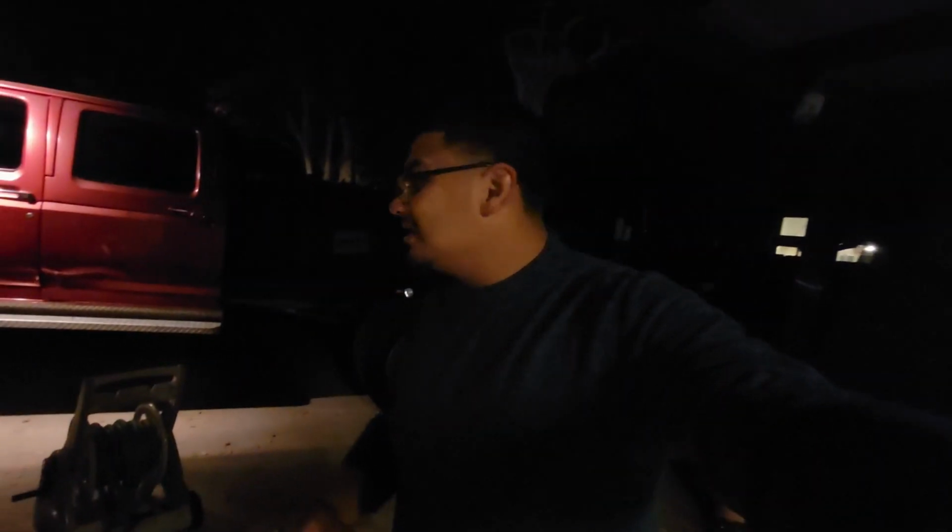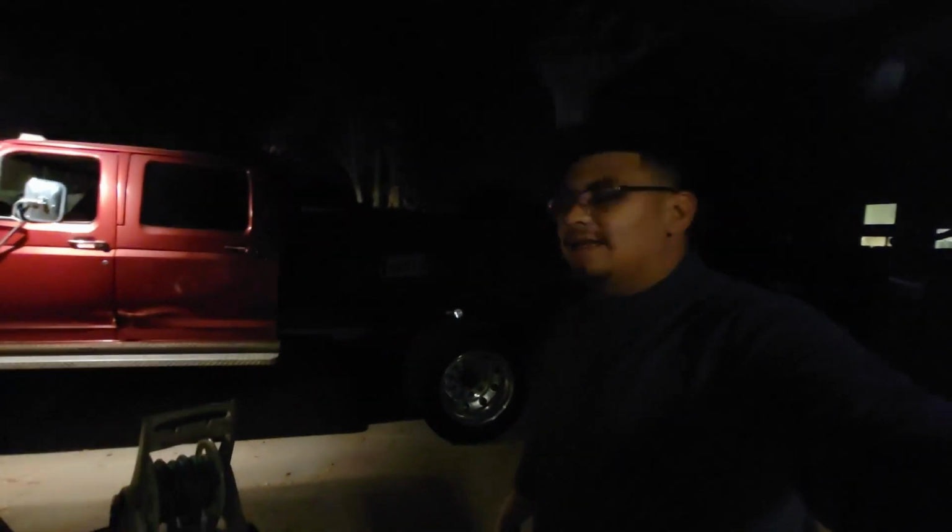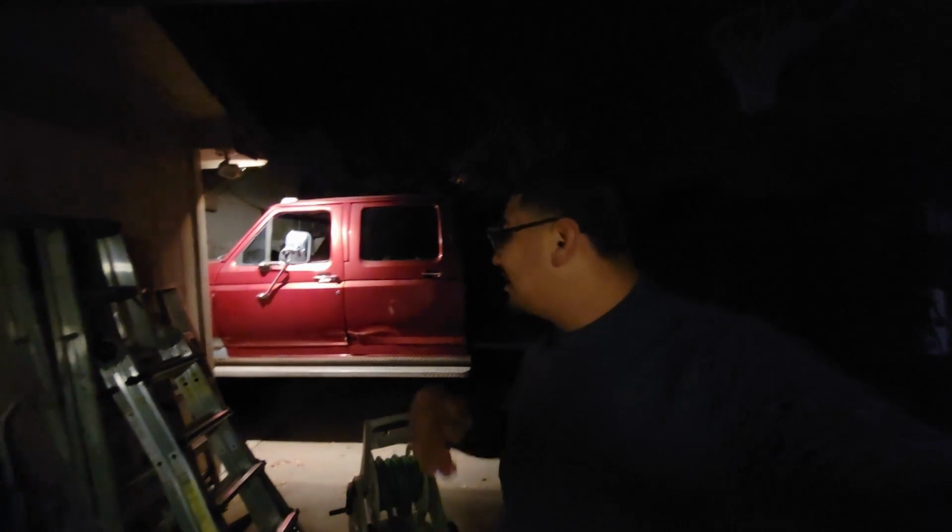What's going on, YouTube? So, today we're at the house finally. Got the truck here. So far everything is good besides the brakes. We have no brakes pretty much. I think I gotta tighten up the brake lines maybe some more. Then if not, then I gotta figure out what's up with it. I know that right caliper actually locked up on me, but either way, you know, just trace it. But for now, we're gonna work on the flatbed.